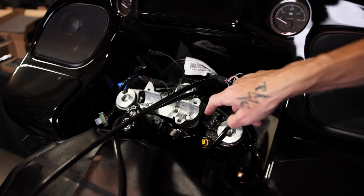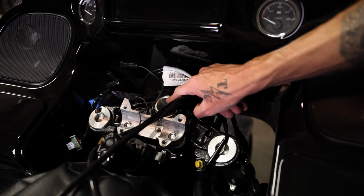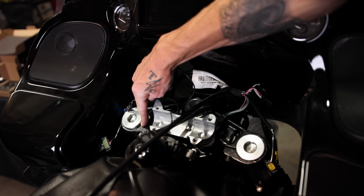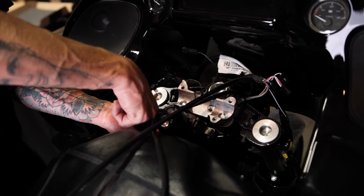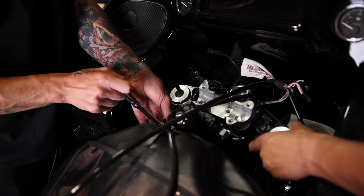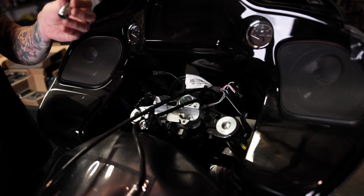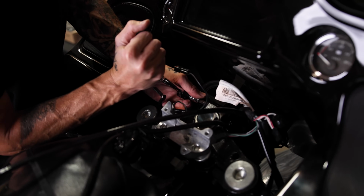And now we're gonna take the top tree off. Keep in mind, you do not need to remove this nut. You don't need to touch it. We're only gonna touch these 3 pinch bolts and take the tree off. All right, so we're gonna start by loosening the pinch bolts on the tree. I have a 1/4 inch Allen. Once those are loose, then I'm gonna grab this 5/16. It's a little bit bigger, main stem pinch bolt.